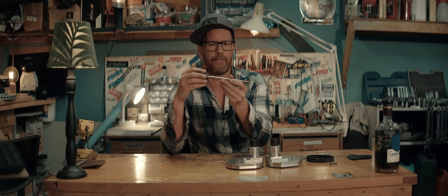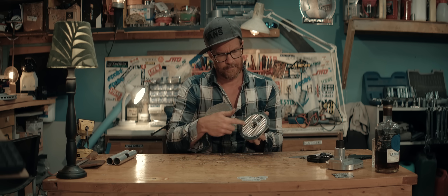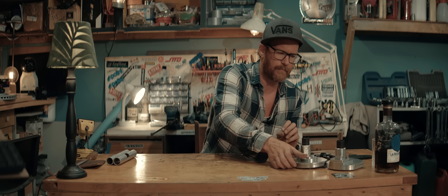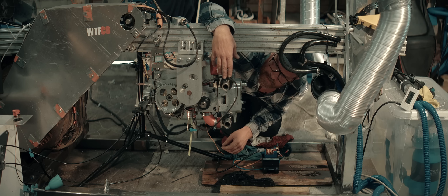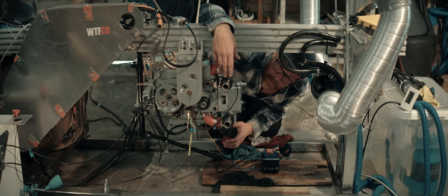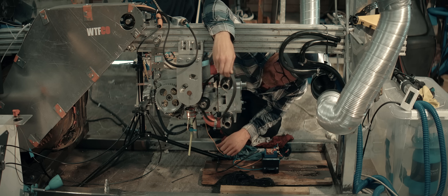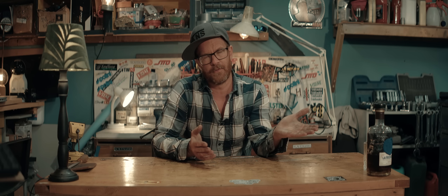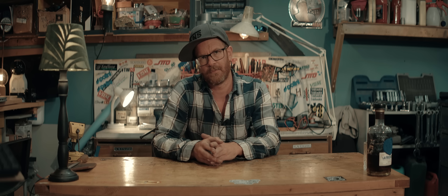But then the axle broke. I have a theory about these disc valves becoming disc brakes under pressure — I've tried to eliminate some friction in the cover but I don't think it's enough. Now we're venturing into combined exhaust outlets and drum valves. This is as far as we've gotten with the drum barrel valves — I'm going to order some sprockets and a chain and switch this drive out without even trying the belt first. No point learning the hard way that rubber belts will melt when driven by an exhaust pipe. The point of all this is creating the most powerful two-stroke ever, horsepower versus cylinder capacity, and breaking some speed records at Bonneville.